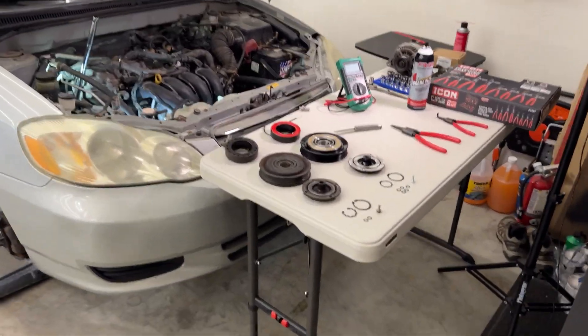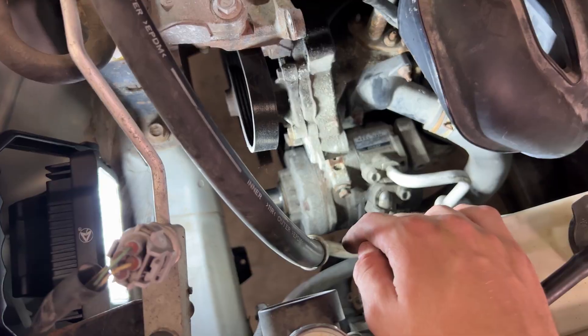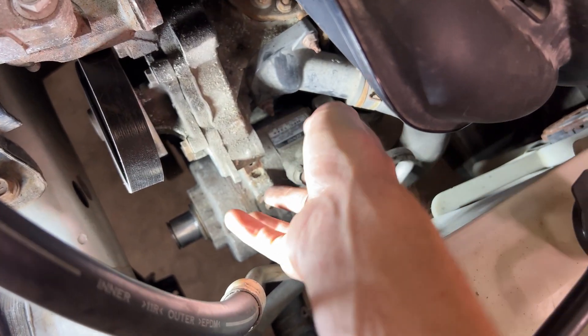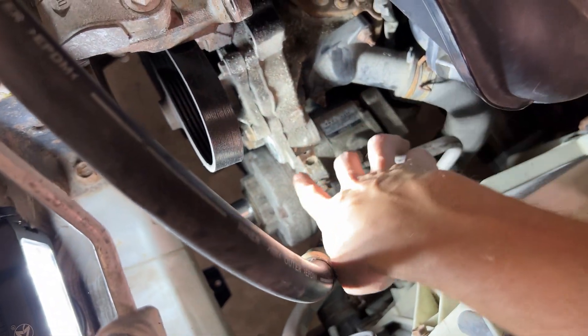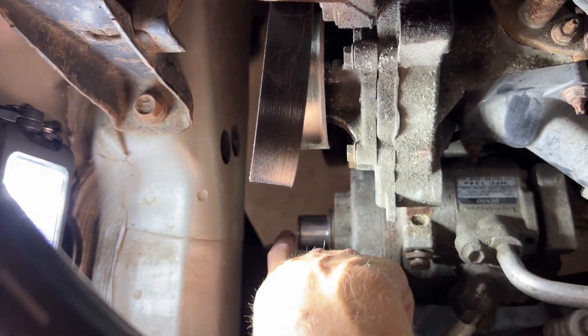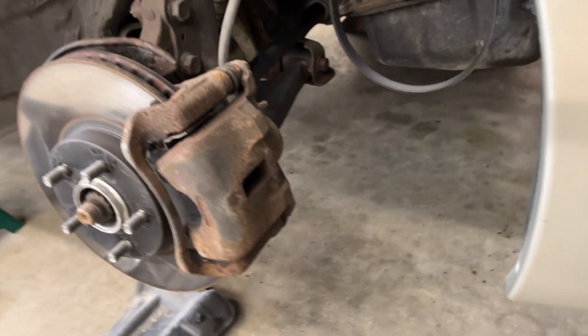Here's what we're working with. Before I show you the parts, let me show you how we remove them — it's actually really simple. You can just use a standard breaker bar and socket, put it on the belt tensioner there and pull it back. That'll release the belt tension on the serpentine belt. I removed my alternator, which is just two bolts and then a couple of electrical connectors. I have the harness pulled back here as well. That gives me plenty of room to get to the compressor. The AC compressor is held on by one bolt on the top, two underneath. I have just the top one connected right now, which lets me show you how you're able to move it because of these soft lines being connected. Once you take that bolt out, you can move the entire compressor back as well as angle it, which gives you the room to get a wrench in there as well as your ring clip pliers. I also pulled this piece of plastic out of the way, which gives you lots of access from underneath.